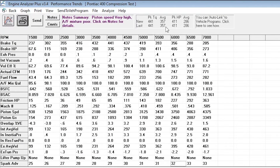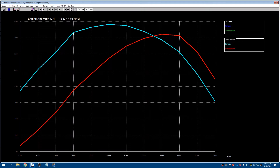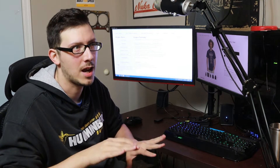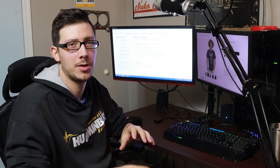The peaks look really nice and the averages also look fairly good. We're using a 1,500 to 7,000 RPM range to keep consistency across all our videos. Looking on the graph, we see a really nice long torque curve and a nice long horsepower curve. I should also mention this cam might be a lot too big for a 7.9 to 1 compression ratio — I wouldn't run this cam in less than about 9.5, maybe even 9. But that really speaks to dynamic compression ratios, which we can talk about another time.